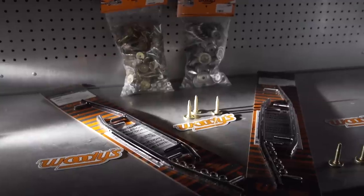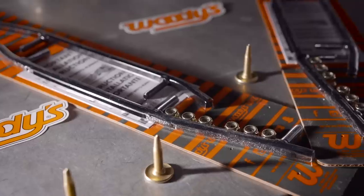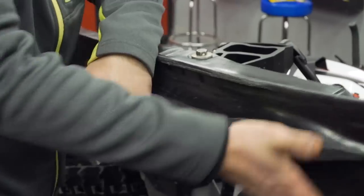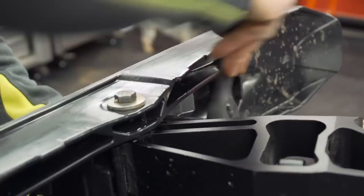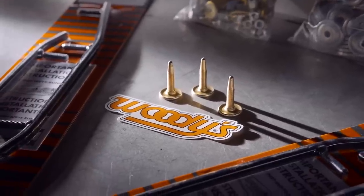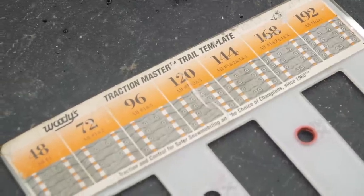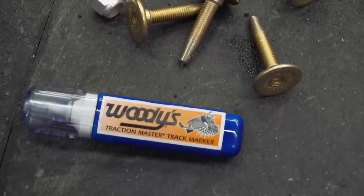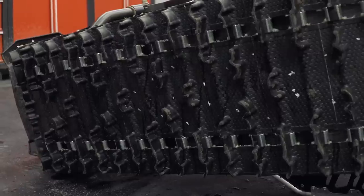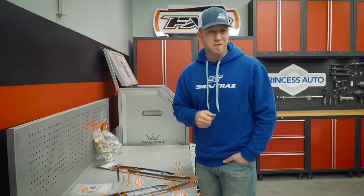On its own, not a chance, but when we enlist the help of Woody's, I think we're in for a real competition. First I'm going to update the complete traction package on the Rush, ditching the almost non-existent stock carbides and going to a premium 6-inch 60-degree carbide runner per side. This will help balance out the traction increase in the rear from the 84 studs we'll be placing on the inner portion of the track surface. We'll be going two studs per pitch and using a simple Woody's traction guide to help keep us lined up, along with the Woody's track pen to mark the places we'll be drilling.